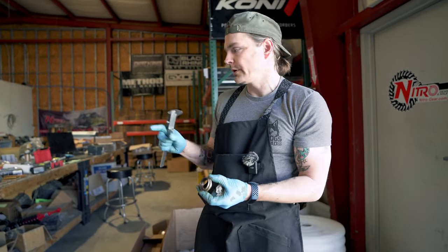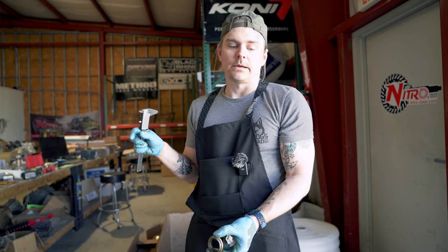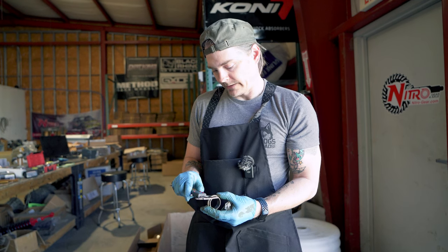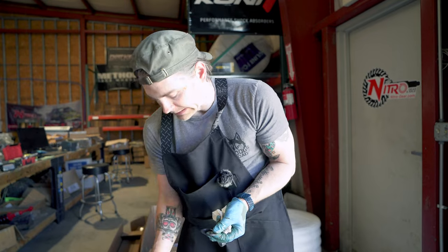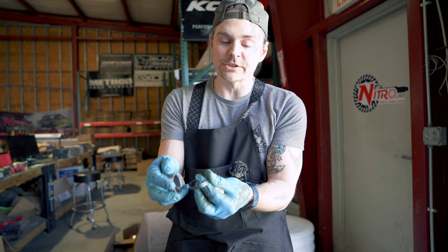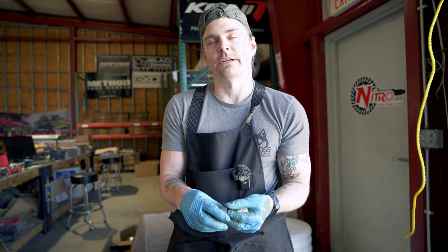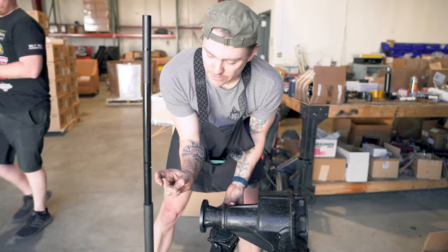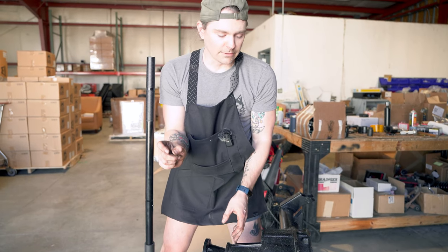This is kind of a trial and error process. We'll start with the height measurement taken with the new bearings — our measurement is 0.5620. Compared to your crush sleeve, the solid spacer is just a solid ring, and on the Dana 44 you use variable thickness precision-ground shims to set your height. With the solid spacer right now, we're too thick in our spacer because we've got too little preload. So we will take this apart, remove the thinnest shim, and see if that gets us where we need to be.